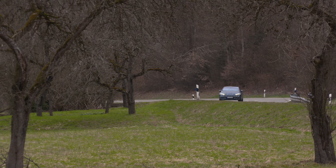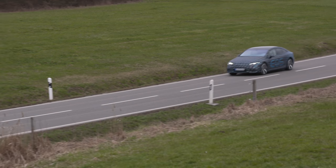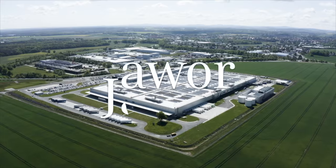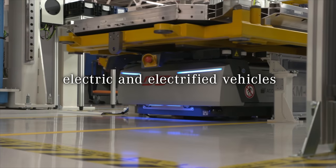If you wanted to change your charging curve or increase usable capacity later in the vehicle's life, or allow the battery pack to regen or charge faster under colder temperatures — these can all be updated over the air over time. Most automakers are very conservative at launch and then open things up as they have more data from the field. It's a lithium-ion pack: eight parts nickel, one part manganese, one part cobalt — so 10% cobalt, which is really low by modern standards.